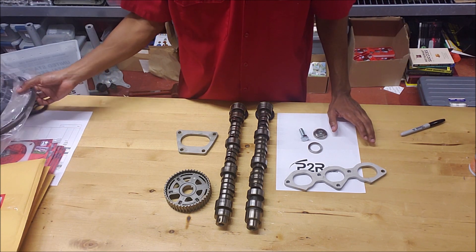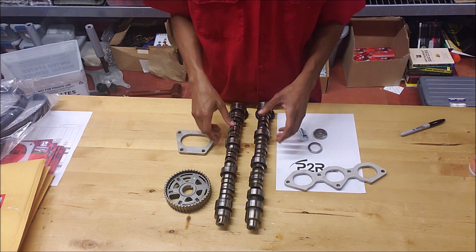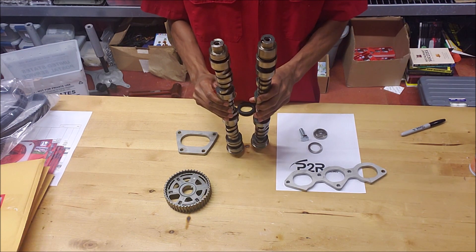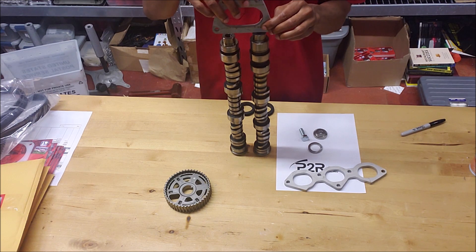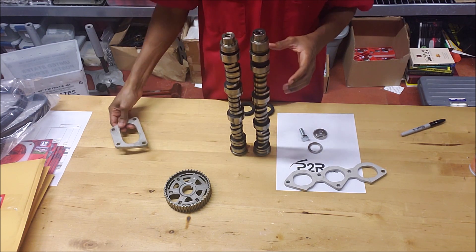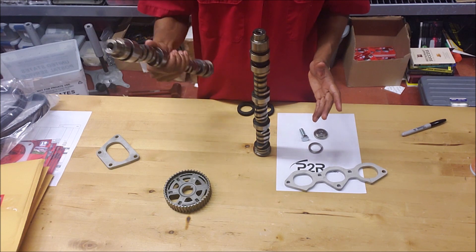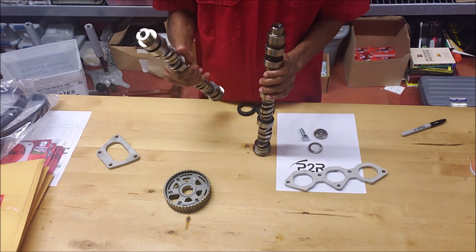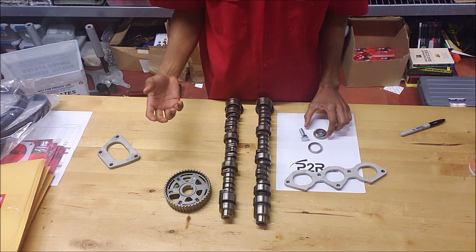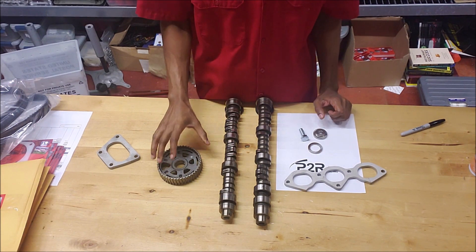Because of the difference in the thickness of the timing belt, the camshafts are actually different as well. If I put these two camshafts next to each other, you'll see that this camshaft is slightly shorter. If I stand them up here, you'll see this camshaft is loose — it's shorter. That's pretty much because Honda is using the narrow timing belt. A lot of people are trying to swap the newer camshafts into the older engines, and when you do that you'll have the issue where your cam gear doesn't stick out far enough. We offer a camshaft spacer which spaces the cam gear out so you can line up the timing belt properly.